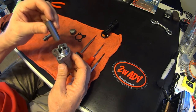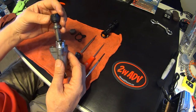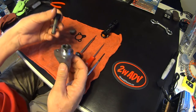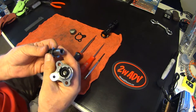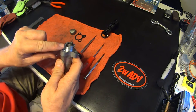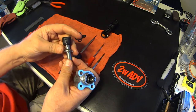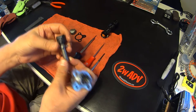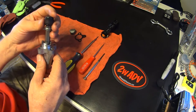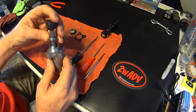Then you take your collar, put that back on, and you're going to take your adjuster. The adjuster is going to adjust the plunger. The plunger has a locking collar that stays on it — it can't come off. You'll notice these have some large grooves and small grooves. Same thing will match on the other side — there's large and small. So I put it in and tighten it down, just screw it on a couple of turns, and then drop this into place.